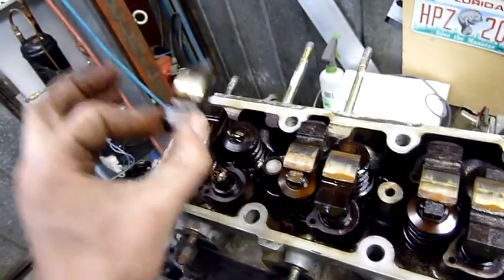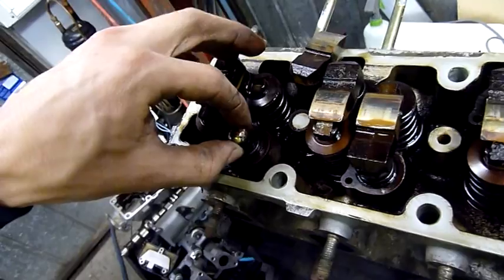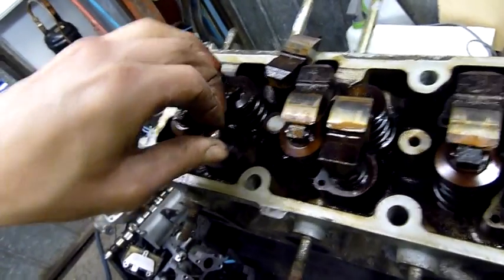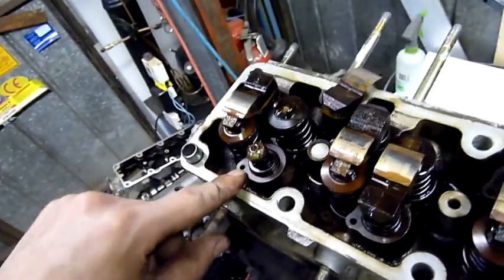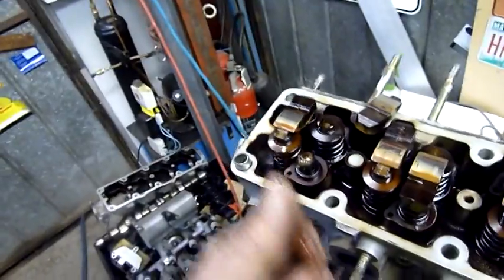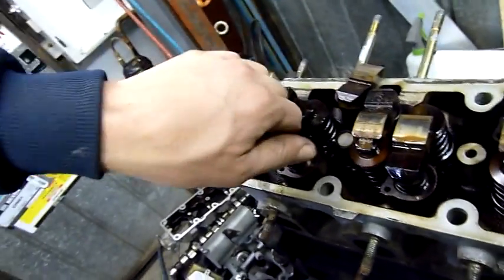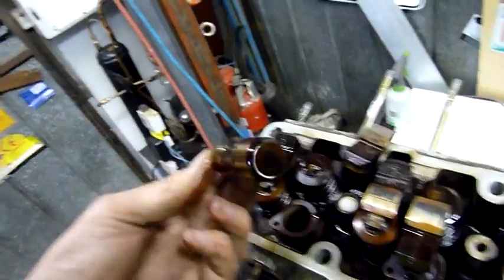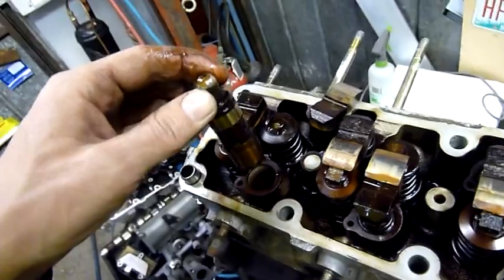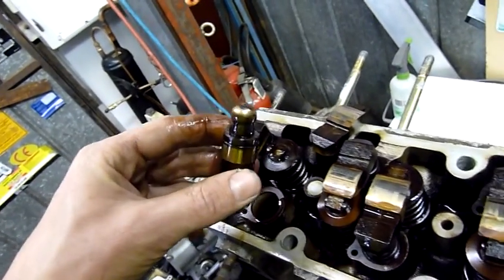As you can see, that's pretty much all that operates the valves - the cam bears down and pushes it down. I can't do it myself because they're very tight springs, but you get the idea. These are hydraulic studs - they are not adjustable, they rely on oil pressure to push them up, and that's a little oil bleed hole. Oil pressure comes in through the head through an oil gallery and keeps constant tension on it. It's just a hydraulic rocker stud - not tappets, rockers.